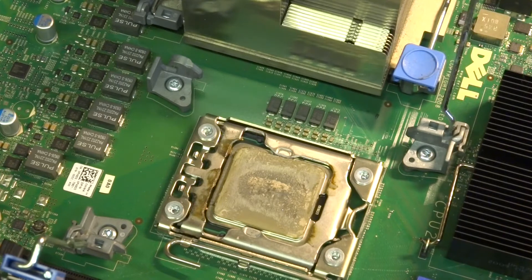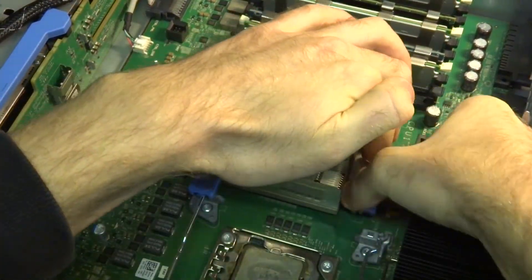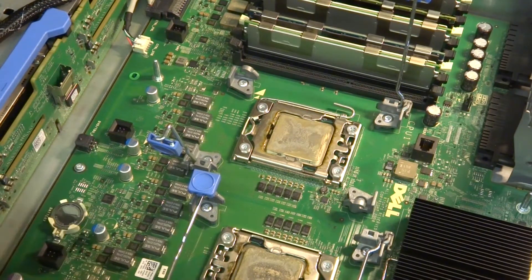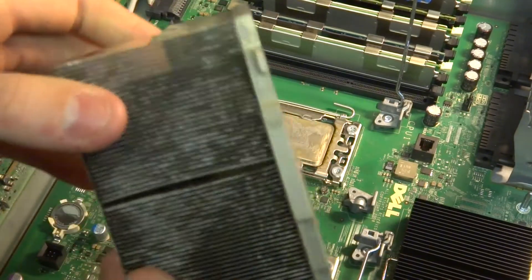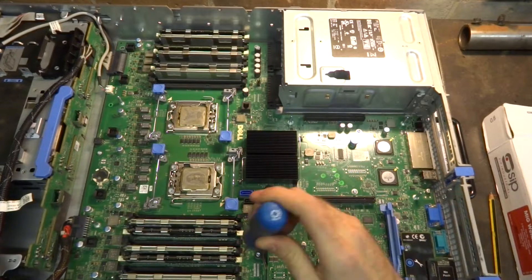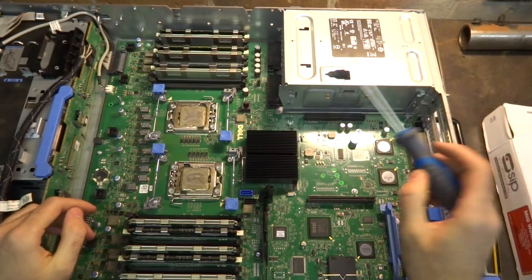It's still a bit tacky, but it doesn't look pretty. We'll definitely replace that. Same story on this one — it looks like it hasn't got enough thermal compound, and whatever was on there, the silicone and other things in it have separated and it doesn't look too happy. There's a fair chunk of a passive cooler on that. For anyone worried about static, my workbench underneath is metal and it's earthed.